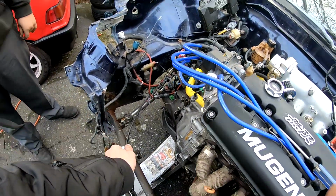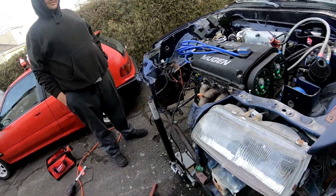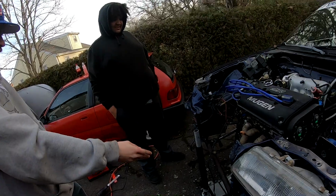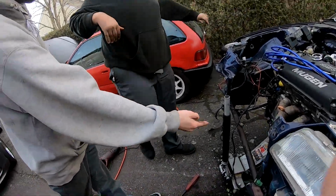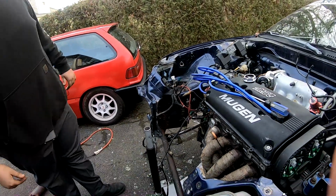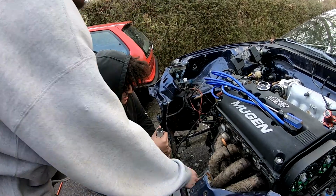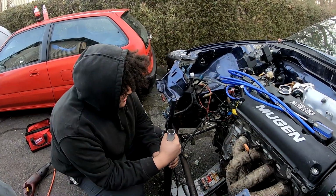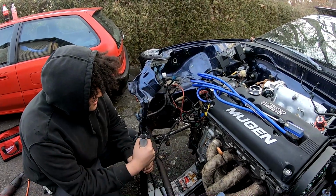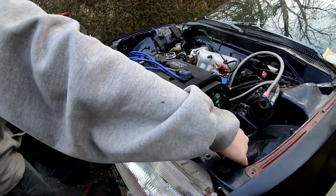How about just the other car? No, it's gonna fall right down on that jack. So you have to be able to pull it out from the car. The traction bar's gonna have to come out? Yeah, because it's going to fall down and be right down here. It's going to clear everything. And to pull it out, we have to cut this front off right here.